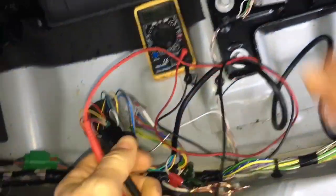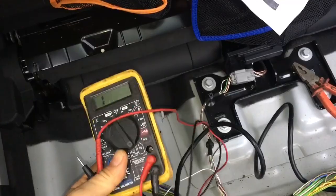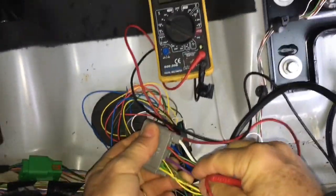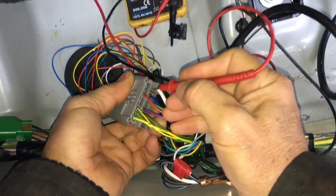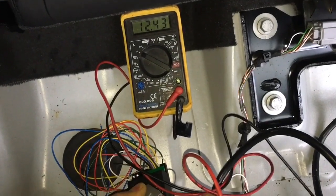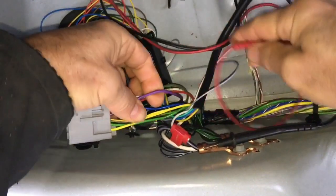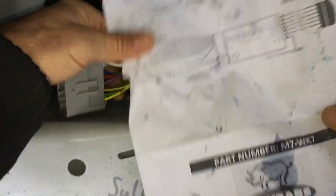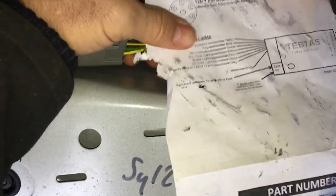Multimeters are about five pounds UK — a very good universal tool. Next, find the permanent live feed on the socket. Set the multimeter to 20 volts on the voltage input and probe around the back of the socket. The one reading 12.5 volts with the ignition off is the permanent live. Use another connector on this one to connect the bypass relay box, which needs power supplied via a fuse to its 12 volt input.